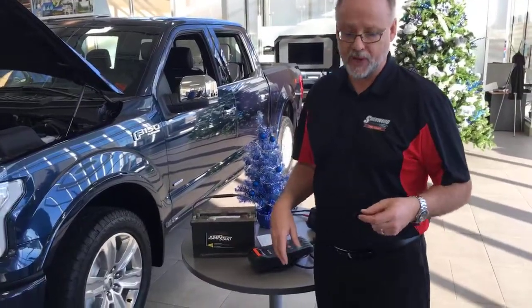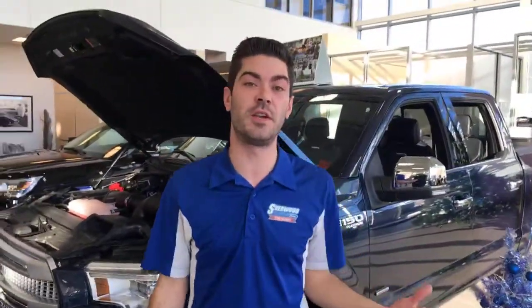Speaking of charge - we haven't seen cold weather yet, but when we start getting into minus 20, minus 30, and sometimes in Edmonton minus 40, that cold temperature can really affect your battery. A fully charged brand new battery is actually going to be just fine until minus 60. But when you've got a discharged battery, if it was fully discharged, it can start freezing at zero degrees. That's where you're going to run into issues of it being minus 20 and your vehicle doesn't start. Going into these cold months, make sure your battery has plenty of power left in it.